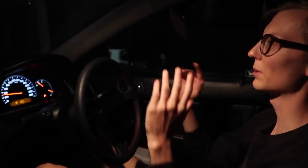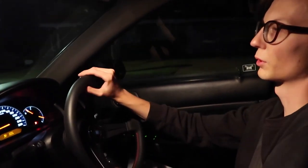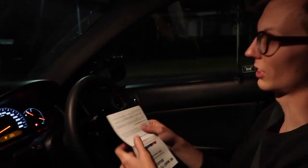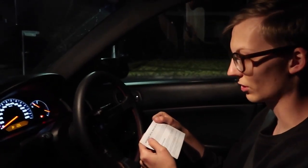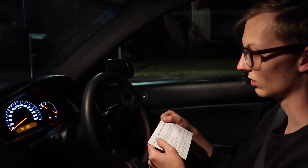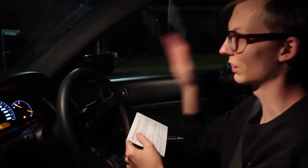It is feeling better already. Maybe there's that coating off the rotors. That's why it felt so weird at first. A bit more moderate pressure there. All right, so now what's next? Make additional 2 to 3 slowdowns, applying heavy pressure from approximately 70 without stopping. Do not drag brakes. Don't like trail braking? I'd say so, yeah. So it's like stop and then like let go. So from 70, a bit higher. How about brace yourself, mate? I've already got my Jesus handles, it's all good.